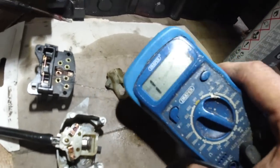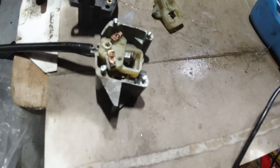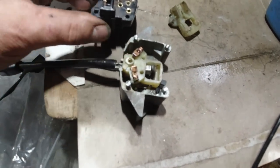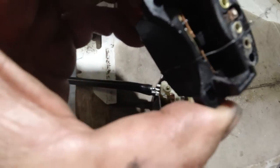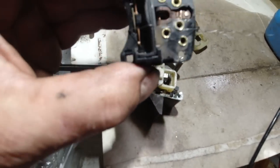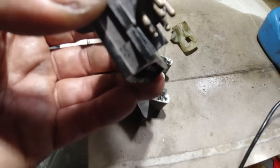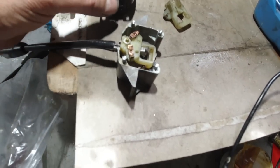I'm going to put a little bit of grease on the moving parts. I've wire-tied that together so that switch doesn't bounce out. That's the high beam/low beam dip switch - that is a very thin cable, it's brake cable strand. I'll cut that and draw it out once I've got the two halves back together.